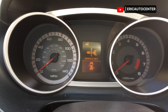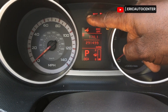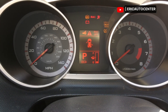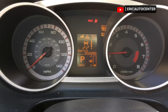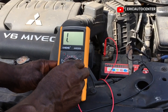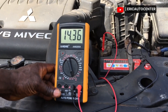To test the charging system, you have to run the engine, turn on the headlights, and let them run for two minutes, then turn the headlights off. Do not turn the engine off — let the engine run. Then turn your multimeter to the 20V DC position, which will give you the required charging voltage.